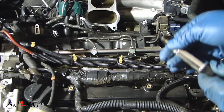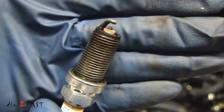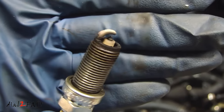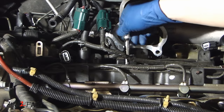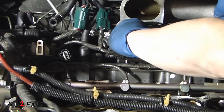So I just took out the cylinder 3 spark plug — let me show you. That white deposit you see there might be due to high temperature and it can cause a misfire. That's why I'm going to go ahead and replace the spark plug.